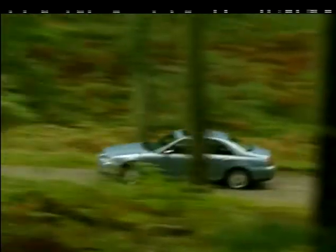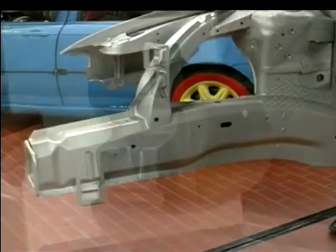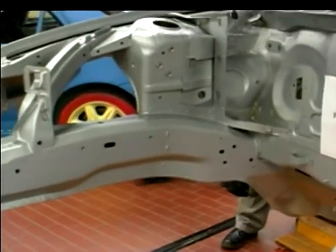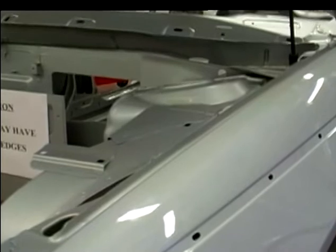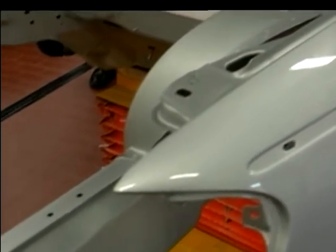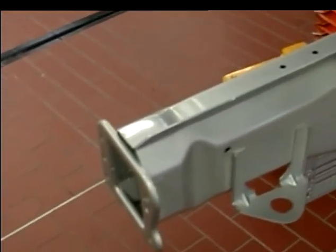You're saying it's two and a half times stiffer than the Rover 600 — what improvements have you made? This is what we call a body section, and it's the way in which we join the different panels together. What we've done is try and make the section as large as possible, because making that section large makes all the metalwork work as much as possible. By making it large we haven't added much weight, but we have added to all the sectional properties which improve its resistance to bending and to twist.